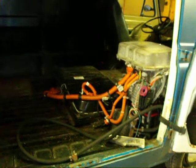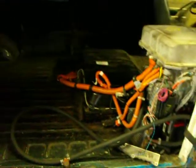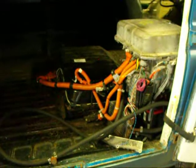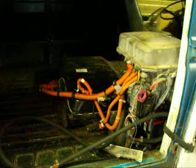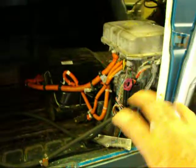It's kind of surprising that the wrong controller worked at all — it was probably just close enough. What I'm suspecting is that because the numbers were wrong, the motor and resolver weren't working together properly, so my hole shot was probably a little weak. And on cruise it was fighting — accelerating, decelerating, accelerating, decelerating — while trying to maintain a constant RPM. I think that's because the signal telling the motor position was a little bit off.